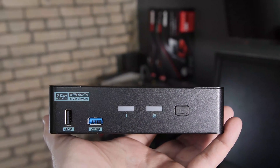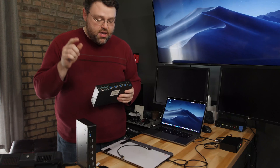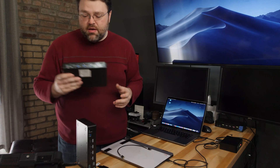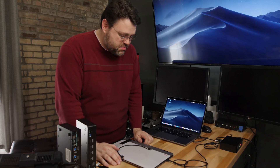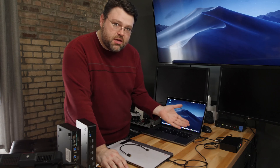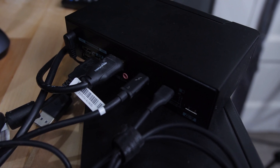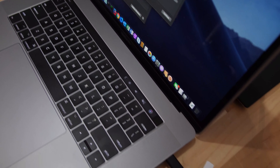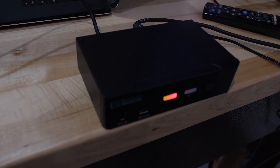The one I'm most excited about is USB-C. USB-C is a giant pain in the butt. If you bought the Level 1 DisplayPort KVM with USB-C to DisplayPort, you probably haven't had the best experience. It works great with a Thunderbolt dock, but not so great on plain USB-C. I've been using Thunderbolt cables for all the prototyping and it works. With the MacBook Pro, the USB-C Thunderbolt connection passed through gives you DisplayPort out of the KVM — so USB-C into the KVM, DisplayPort out to a display with a Mac. Works great.